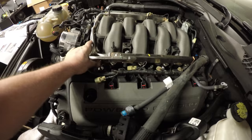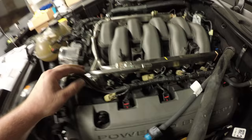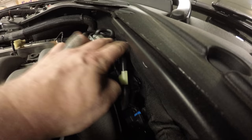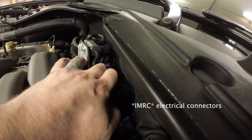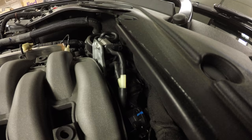I don't think these intake manifold screws actually come out. They get loose and you can pull them up and down, but they just stay there. So it looks like now I'm going to be able to lift the intake manifold out of the car. There's two blue solenoid connectors back here that you have to get your fingers in there, push the tab, and pull those out, one here and one right there. I think it's going to come out now, but I'll update in the next video if it's not as easy as just pulling this out.